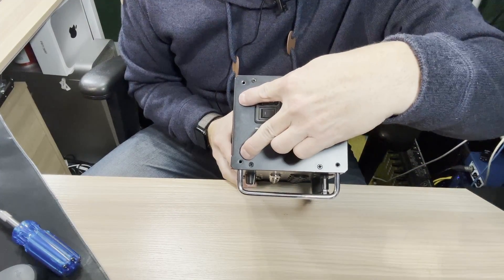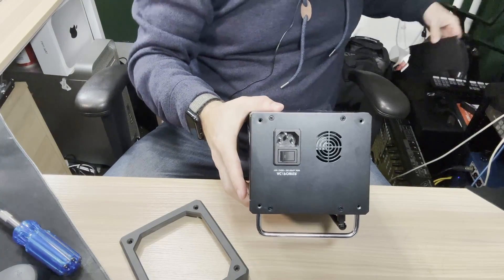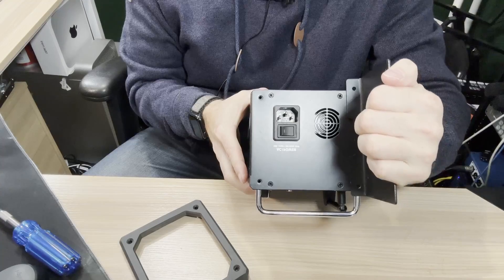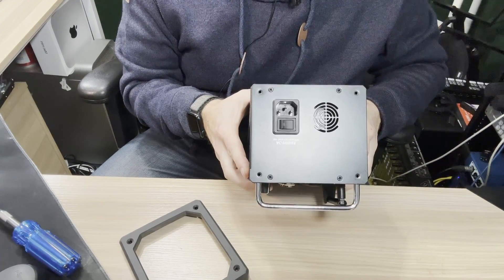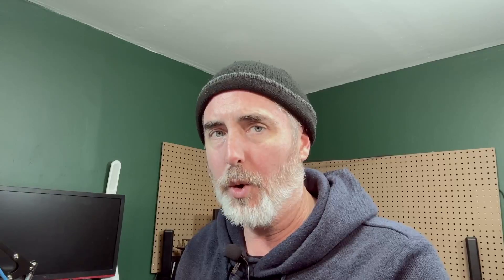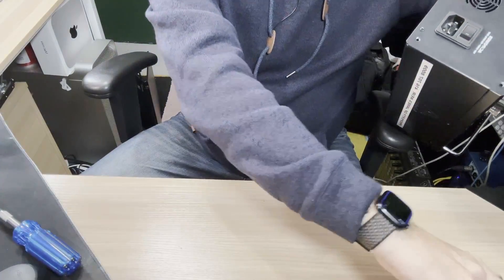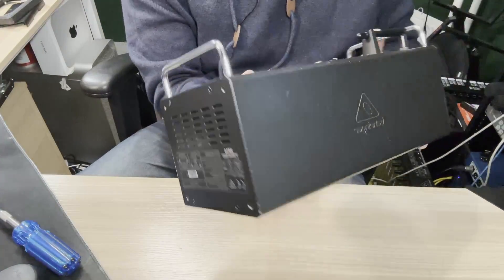You'll notice these holes are open — these are used to mount either the rubber bumpers or brackets for a rack. I have mine out because I took the bumpers off earlier. But these four and the four on the other side for the bumpers or rack ears don't actually hold the unit together; they're just for supporting it in the rack. I would recommend taking them out because it'll probably make it just a little bit more difficult to maneuver the lid off once you've got it open. But they are not there to hold this box together.